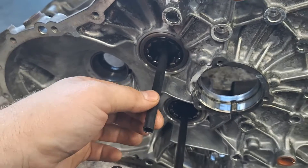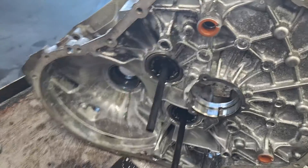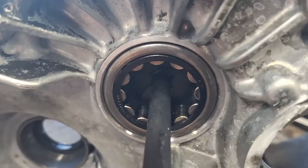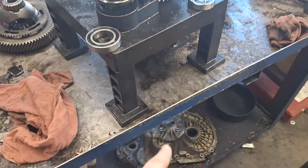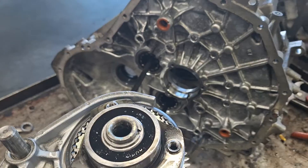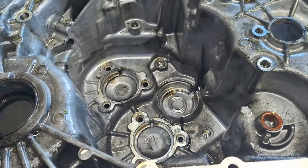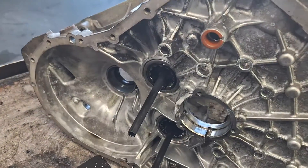This one doesn't have a snap ring on it. There are these feed tube seals that are cracked and kind of misshaped. I'm told those aren't a big deal to have in there at all, but I want it to be right — it looks like it'll at least function for now. Those are completely sheared off on my other case, so I'm not even going to use that one. The other side of the output shafts slides into those bearings, so these straws will come up through here and point into the empty spot in the casting of the case.